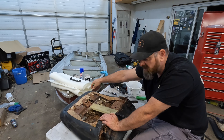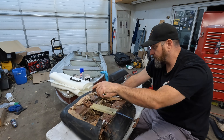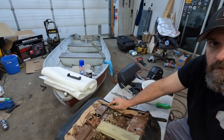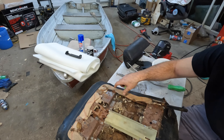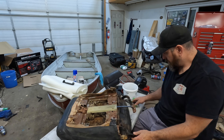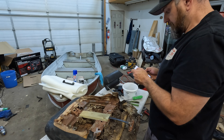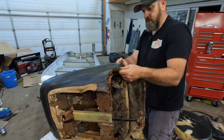I like to make notes of how they do this and hold them in. You can see here they basically pinched this top section together up at the top to make the seat tighter. When I'm putting the other covers back on, I may do the same thing and put a hog ring up in the top here to pinch this together a little.